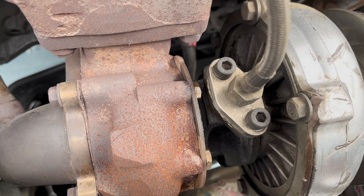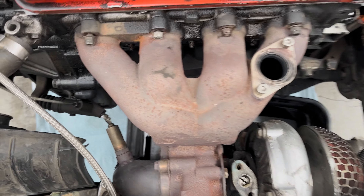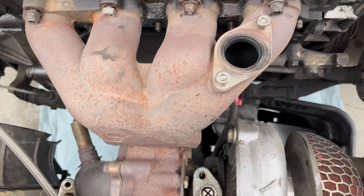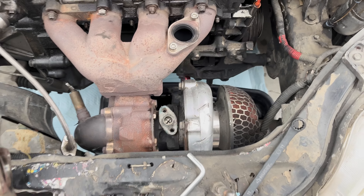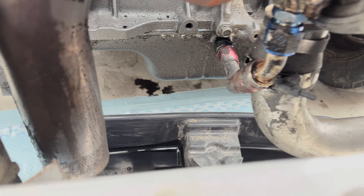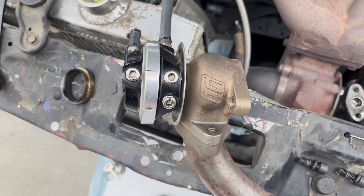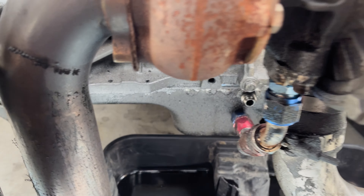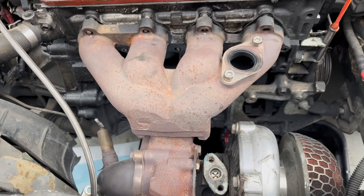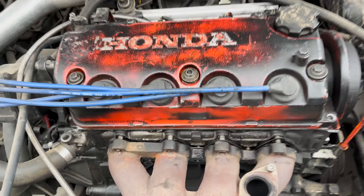The feed line looks okay, but that other gasket is definitely gone. The wastegate is out, I got the nuts on the bottom, and I just need these four on top. I disconnected the intercooler from down there so now this should just pop right out. Everything is off — all the nuts from the exhaust manifold studs, the wastegate, the oil feed line, the bottom studs. I just disconnected the line so this thing is ready to come out. Look at all that oil dripping — that's because the valve cover isn't sitting well because of this bowl right here. I'll fix that soon.